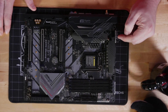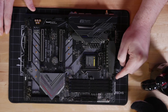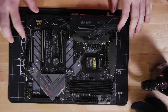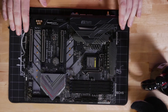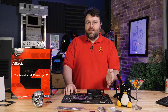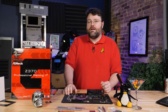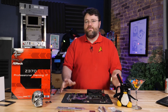At the top edge of the motherboard, we've got an 8-pin CPU power connector, a 4-pin fan header, and another 4-pin fan header right behind the four DDR4 DIMM slots. At the front edge of the motherboard, we've got our XMP on/off switch. XMP — Extreme Memory Profile — if you're scared of UEFI, move the switch to a slightly different location. If you turn that switch on, it'll automatically use the XMP profiles on your memory sticks and you'll get the speed benefit from that.